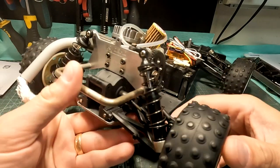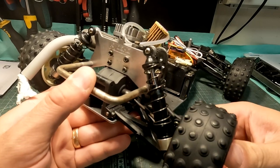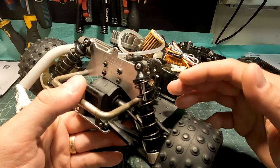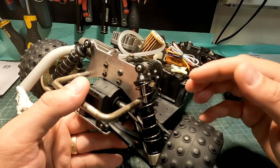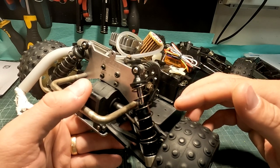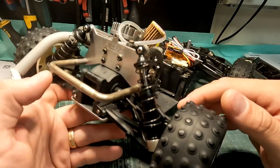As you can see, the rear shocks are inverted because they were leaking, so I inverted them so they don't leak. It's not very original, but it's a simple fix. The O-rings cannot be replaced because the shock internals are pressed down, and you have to break them apart in order to take out the O-rings.